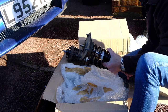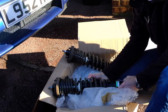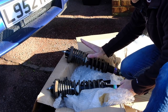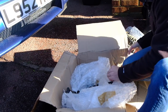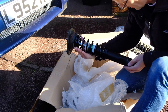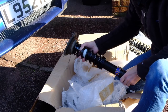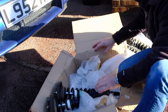So the top mounts are the original, which has again saved money. This whole process is way cheaper than buying a new set of struts for your car. Same as fitting tyres or shock absorbers in any regular situation — always do things in pairs. They've got a pair of original matched coil springs and a pair of new matched coil springs at the front. I could have gone for a brassy coloured zinc coating, but I felt the black is slightly more long-lived, so I'll go with that.